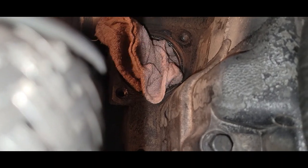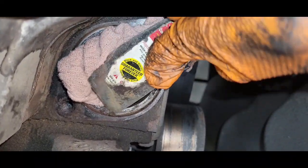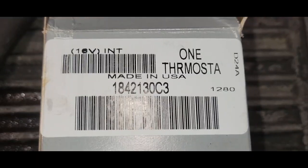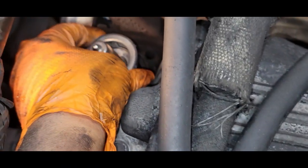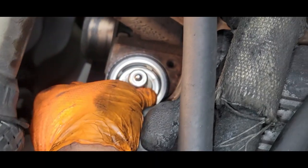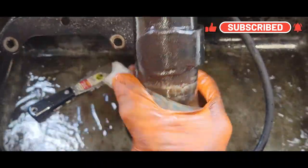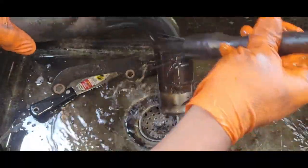We're going to make sure we wear safety glasses. I'm just going to make sure our edge is clean for our seal — we don't want any reason to have a leak. Here's our new thermostat. It came from our local International dealer. Let's drop it right in place — fits like a glove. Now is a good time to actually clean the pipe; we'll take some emery cloth and clean the section that goes onto the hose. You don't want your radiator hose to have any reason to leak. We have everything cleaned up.